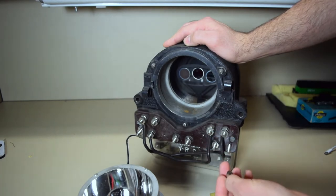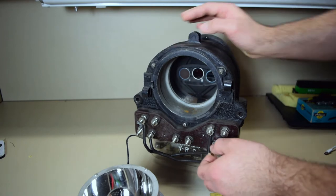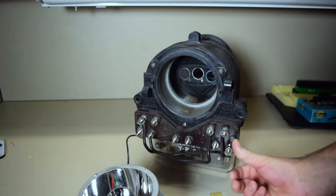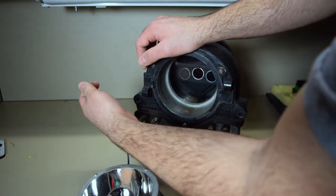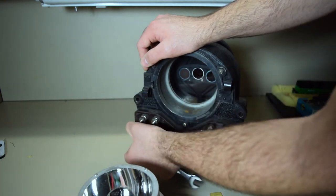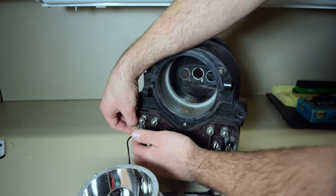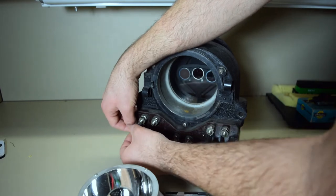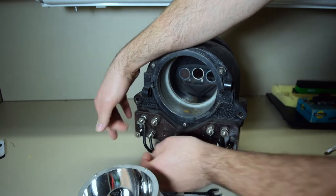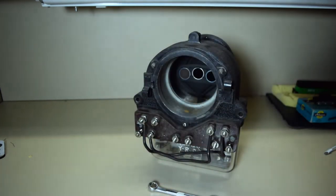The plate that goes to one of the bulbs comes out right here. To prevent accidentally pushing the bolt that the plate was sitting on inside the mechanism, just thread the nut back on so it won't disappear and you won't have to fish it out. Do the same with the other one. Now the parabolic lens and bulb are out — we'll put those to the side.